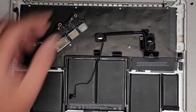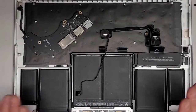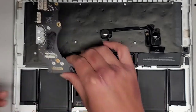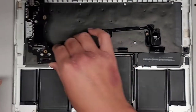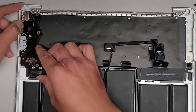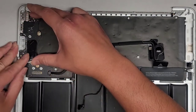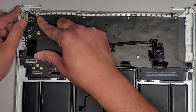I'm back. There was actually quite a bit of water in the bottom part of this battery area. Hopefully the battery is okay. We're going to reassemble this and we'll find out. When I blew it out, there was also a lot of water in this area as well — we'll see what's going on with the SD card slot. Hopefully I'll have an SD card to test. We'll also see if the HDMI works and the USB port there. So to put this back, I'm putting this at an angle — you want to get these metal tabs here underneath. We're going to get this all lined up and get these screw holes lined up.